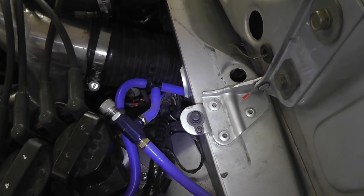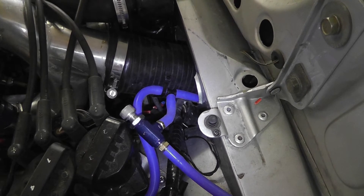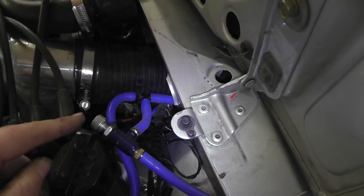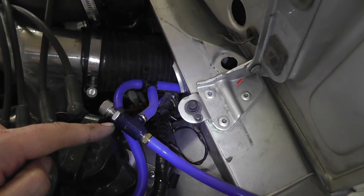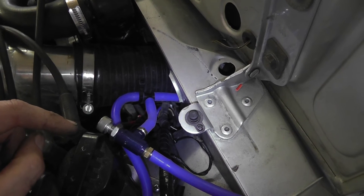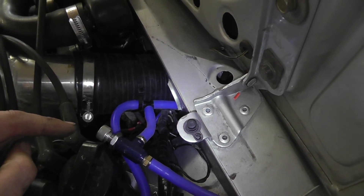The way I've done that is to use basically a wastegate actuator plumbed via a valve, which is my bypass valve. That opens when it sees a set pressure. A ball valve stops the valve from seeing pressure prematurely, so there's no creep on the valve. When I hit my preset of 20 psi — 10 psi on this valve — the actuator sees 10 psi and begins to open the bypass valve. At 10 psi it's probably three-quarters open, and as the turbo makes the additional 10 psi it's fully open.